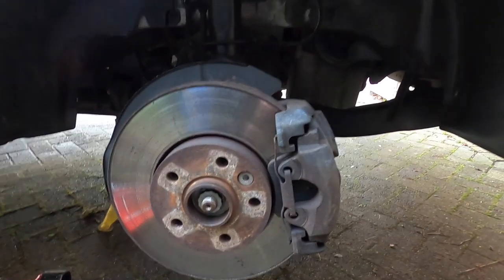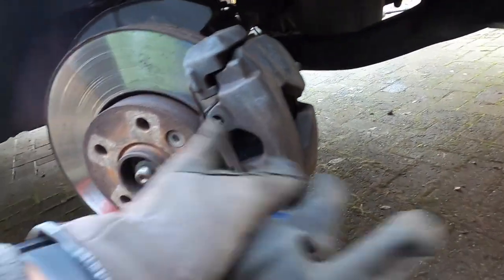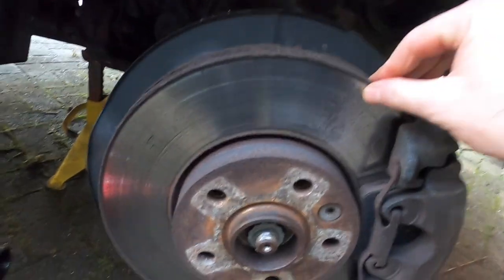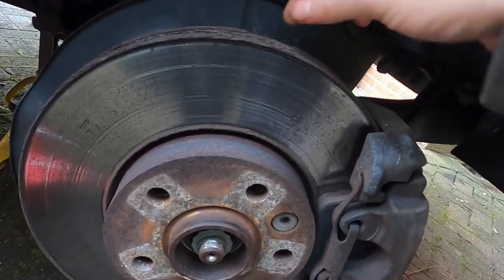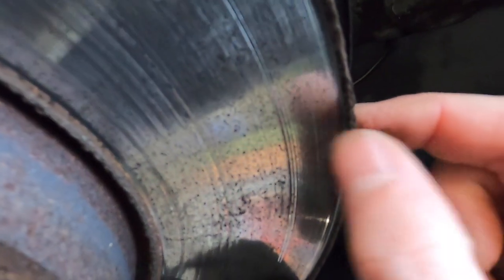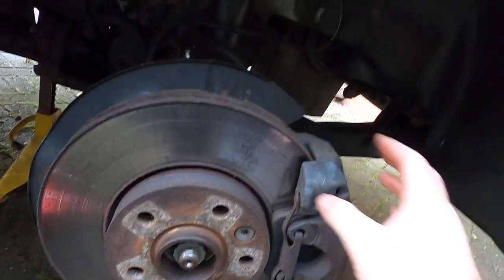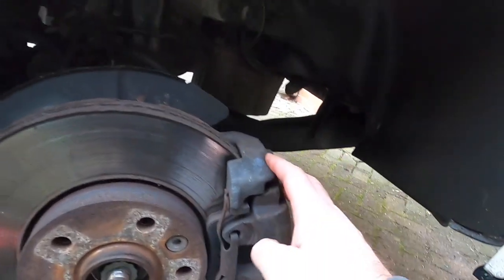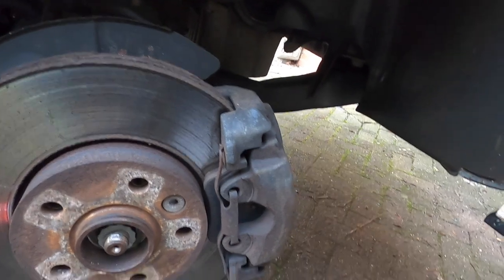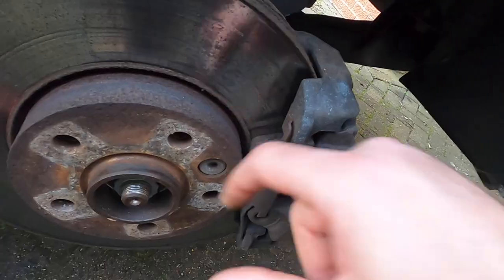Wheels are off now. As you can see, it's just dead dull. Need to clean up from that. Clean up all the discs. These ones are not as bad as the back ones were — they were knackered. Still have ridges top and bottom. So like I said, I've got new ones for them. Take these off, take the calipers off the brake assembly. The pads don't look too bad but — new discs, new pads.